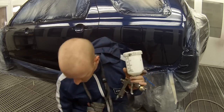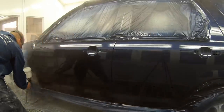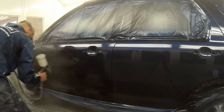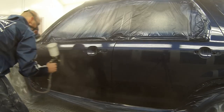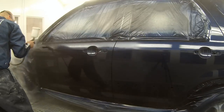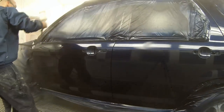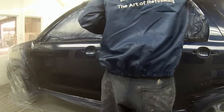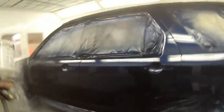Here we go for the second coat. As I don't actually have a gauge on this gun I'm just judging it by ear. You can pretty much just hear the air pressure and you'll know when it's right — you know when you're at about 2 bar. A lot of it is also just by feel. If it's not going on right you can either jack the pressure up or turn it down. Play around with your settings and after a while you'll get the hang of where your air pressure should be. Even though my other guns have regulators on them I still judge air pressure by ear.